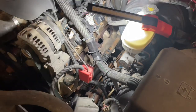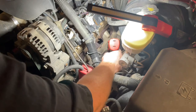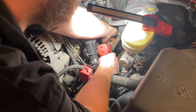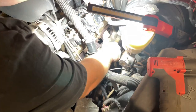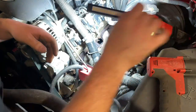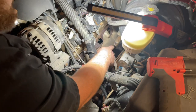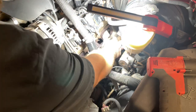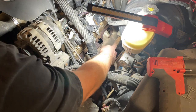I'm hoping this Snap-on impact is going to get it done. One thing to be careful about - I've run into them where the tab will bend and freewheel, and if your hand's in there it messes up your fingers pretty bad. Luckily that came out - that's a miracle because usually these things are rusted together here in Canada. What I usually do is put a vice grip on the steering shaft and hammer it up or use an air hammer. Sometimes they're so rusted together it's insane.